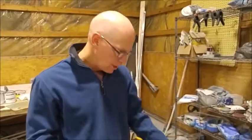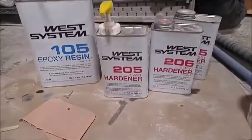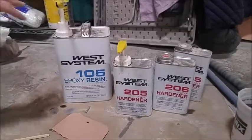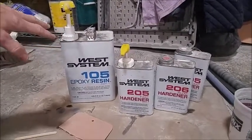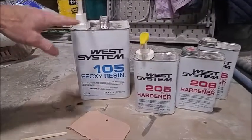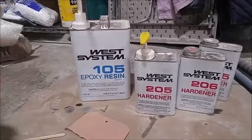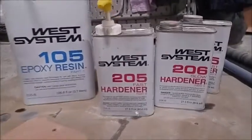West Systems makes an epoxy product. They have their 105 epoxy resin and their 205 fast hardener and their 206 slow hardener. And these are 5-to-1 epoxy to hardener products. The pumps that are on the cans meter them out perfectly,